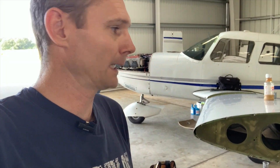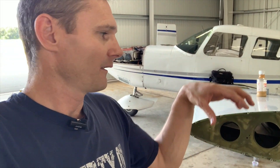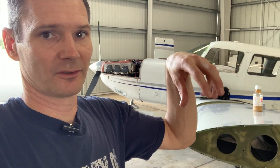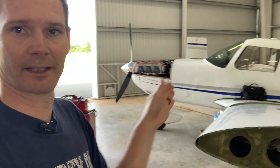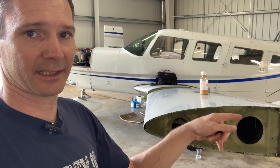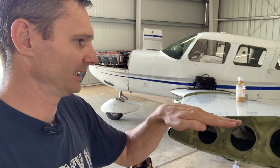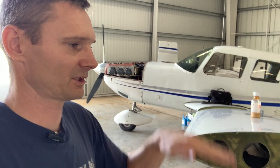It's about 30 minutes to take the gas tank off, probably 45, maybe even an hour to put it back on. But it will be a million times easier to mount that bracket and to get the GMU in there and level and aligned exactly — this way, this way, and that way — with this thing off. Next is to mount the bracket, then get the plane level, and do all the measurements to make sure it's exactly square and straight with the airplane.